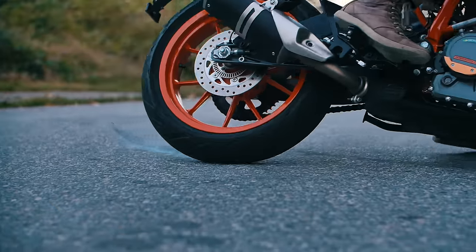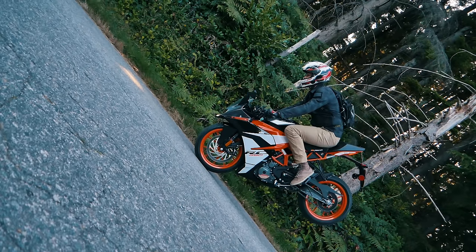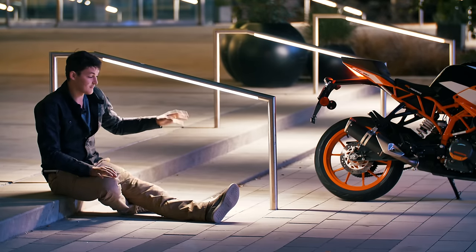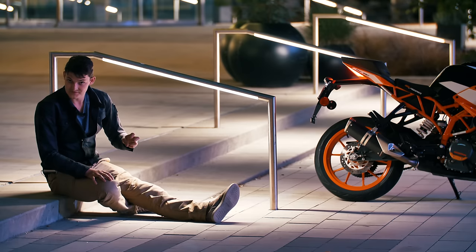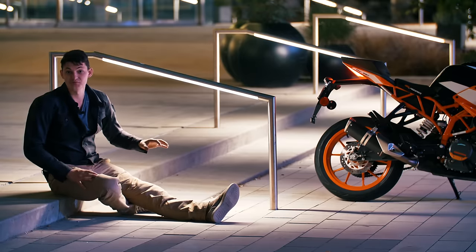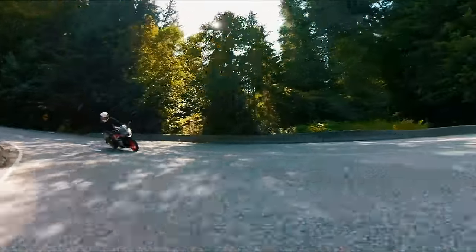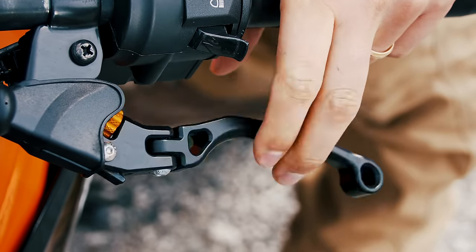Yep, KTM's extravagant obsession with race prepping this machine left ABS switchable. Of course, you won't inadvertently slide the rear on downshifts because they also splurged for an assisted slipper clutch. Whether you're slamming shifts in a race or flubbing shifts in rider's ed, it smoothens an unsettled rear tire. Added benefit is the super light pull. Racers use one finger for precision, beginners can use two without tiring.